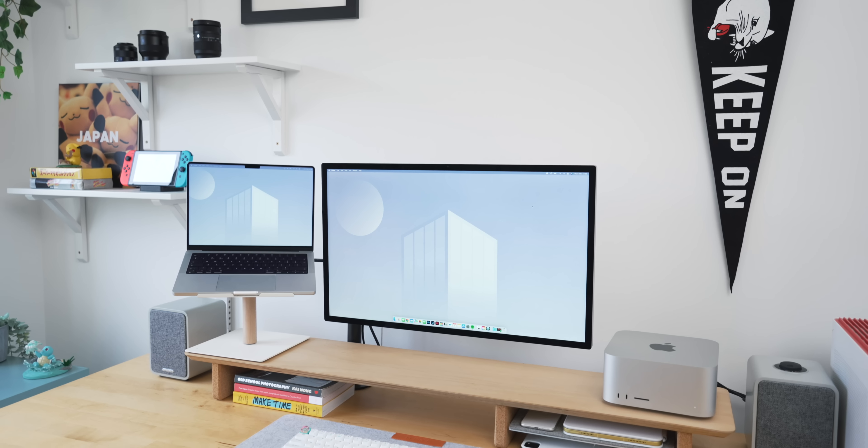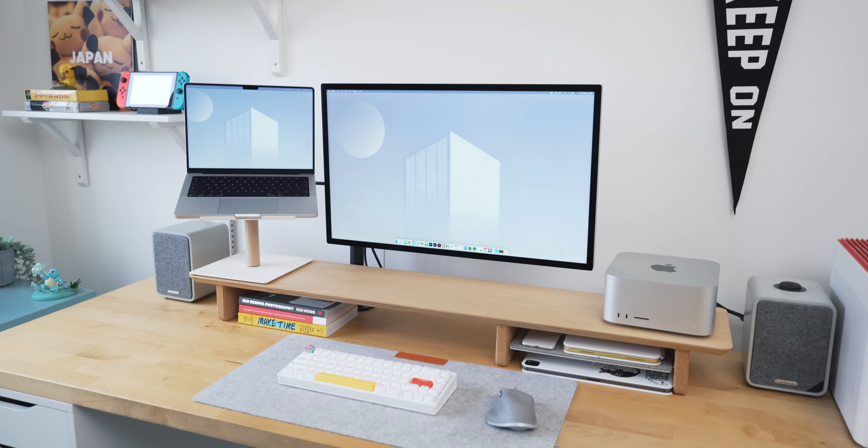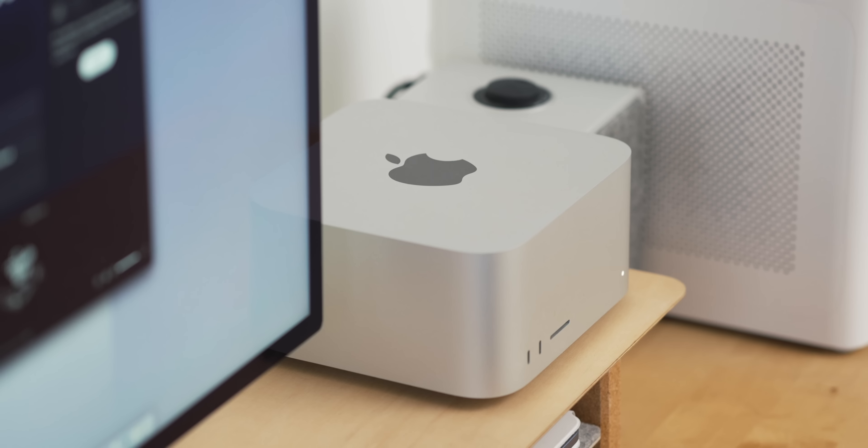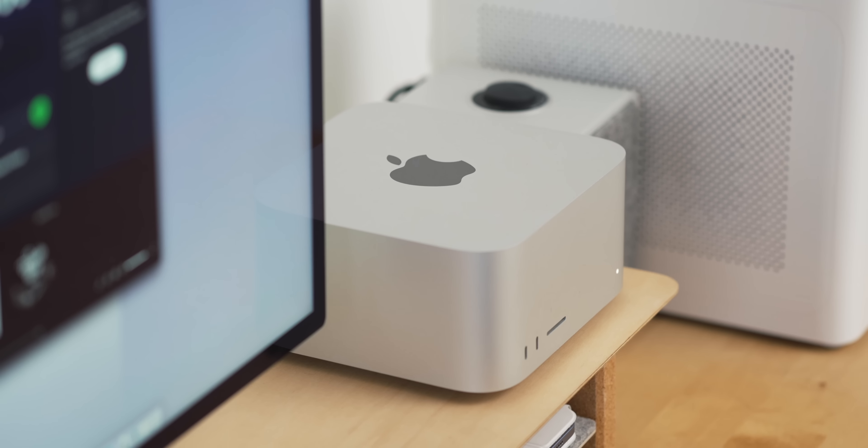I thought, let's go for it — this monitor is going to be a big upgrade, I'm going to get really nice colors and all of my setups back. But unfortunately, that's not the case. Most USB-C dongles, including the one I have, are more of an output device — they don't act as an input device. So you can't put an HDMI into it and then into the USB-C on the back, because it just doesn't work that way. And that turns out to be the case with pretty much every single one. So suddenly I actually only have one input: my Mac Studio.